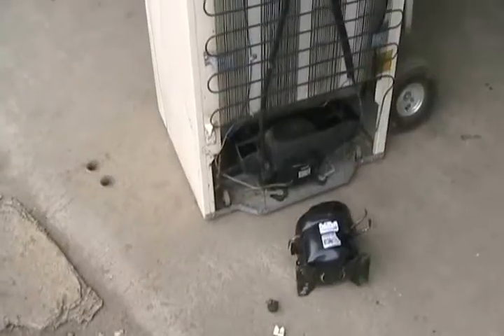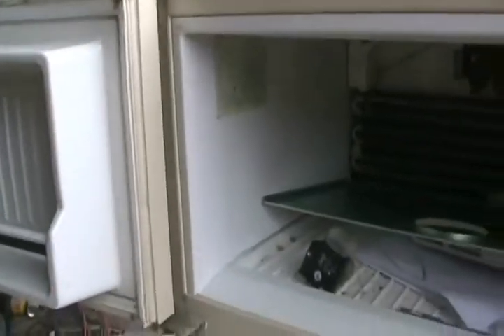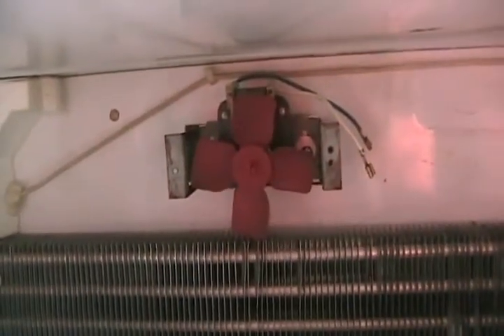Another sort of electrical problem is your fridge fan. A common complaint is it sounds like there's a little bird chirping or squealing in the fridge going off and on, or the freezer is fairly cold but the fridge is warm — just like a defrosting problem, but it's a fan problem. In that situation, your compressor's running, the coils are warm, your cooling system is cold, but when you open the freezer door the fan isn't running. Some fridges have a switch that shuts the fan off when you open the door, so ascertain whether it has that. Usually what happens is the fan seizes up, and as it's slowly seizing up it's screeching and chirping like a bird.